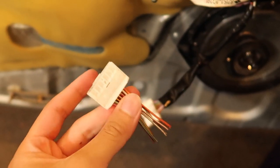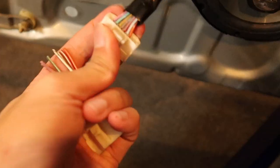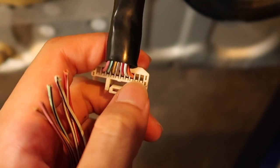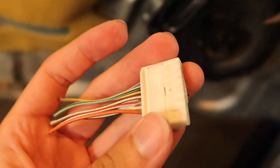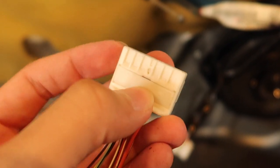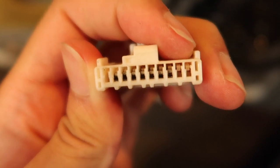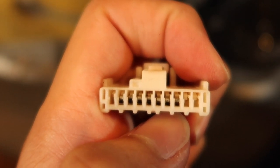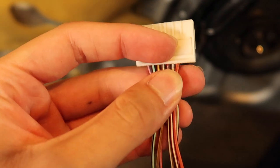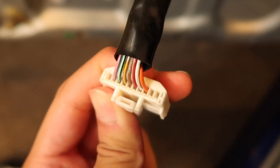So we're back. The other day I went to pick and pull and I was able to get one of these — basically the same thing — but all I need are just two of the wires right here, so I can put two pins into these two slots right there. To do that it's pretty easy, but you do need a really small tool. I have this really thin pick right here. Basically all you have to do is lift this cover up — put the pick in that little slot and then lift it up, take it out, and then go in here. Above each individual pin there's like a little plastic tab. You go in there and lift it up and that'll release these wires so you can just pull it right out. I'm going to go ahead and take two of them out so I can put them in those two slots.